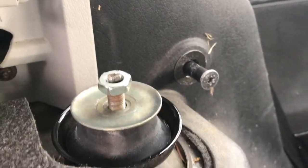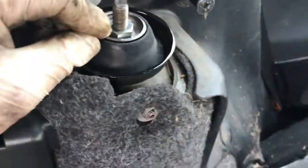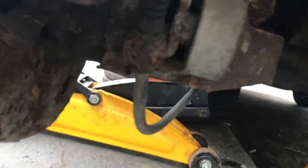So after you've taken that first nut off the top, under that there's a cap, and there's a second nut that retains that. With the rear wheel removed, there is a nut here at the end, and you can pop that out — that's what actually secures the rear damper in position.